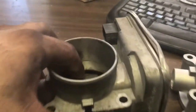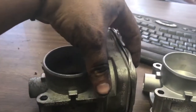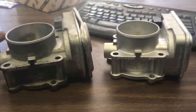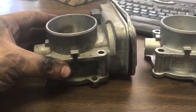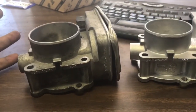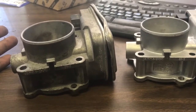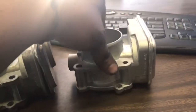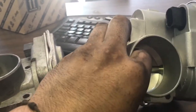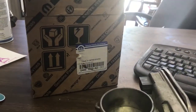It would start opening but clatter a lot. I have this propped open so I can show you exactly what's going on. If you have this issue, most likely it's probably going to be the throttle body. Rather than just saying why it's the throttle body, I want to show you what goes bad inside. This is the brand new one — it's supposed to sound nice and clean when you open it. I bought mine from the dealership; this is a Mopar part.